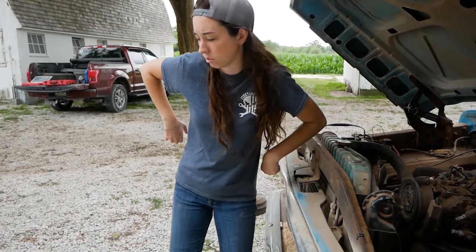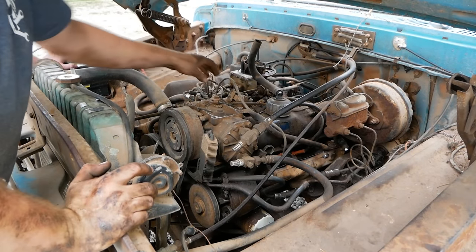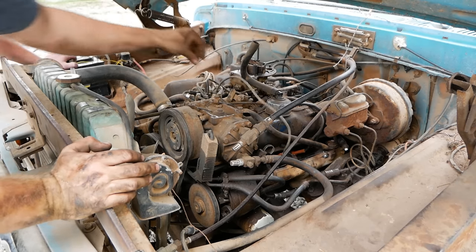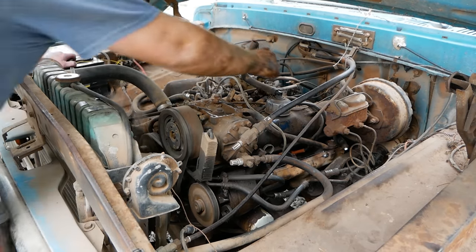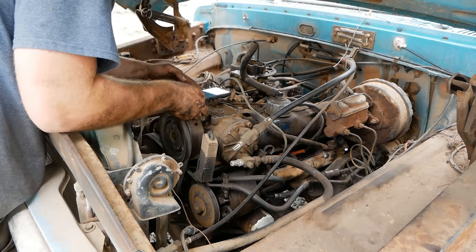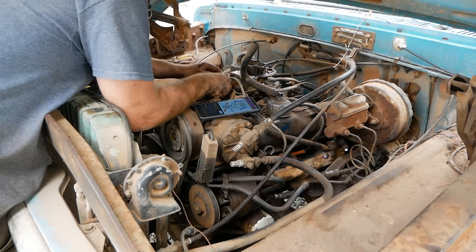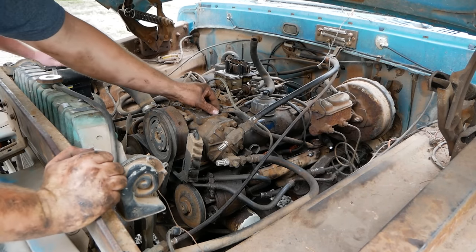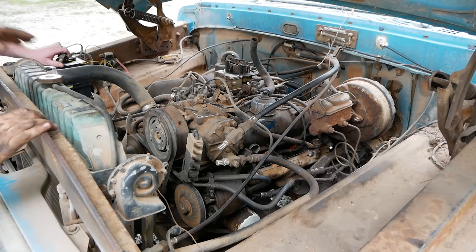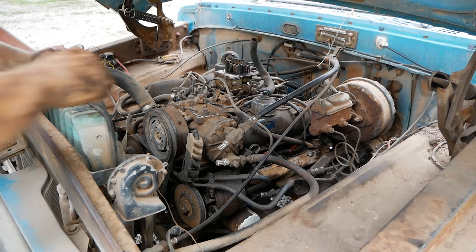All right, back to animals. All right, we got a new plug wire on there. Should have all eight cylinders firing now. Let's give this thing a couple pumps. All right, just coughed through the carb, so we're gonna double check this firing order, just to be sure. Classic Kevin fashion, I got 3 and 7 switched around. Seem to only do that on FEs. God, that's like the fifth time this thing's got me in the head. All right, let's try it again.